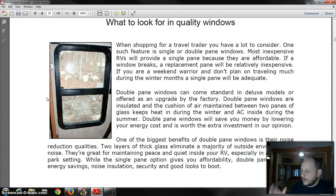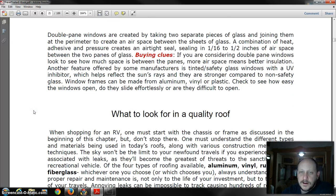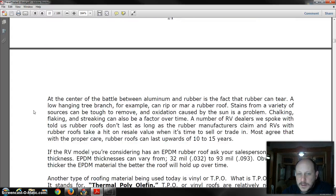If you don't believe me, take a cold glass of iced tea on a hot humid summer day and watch how fast it condenses. That's why if you've got two panes with air in between, that air is a thermal break — it helps not transmit as much heat outside in winter, or let outside heat in during summer. It also helps with noise. Air spaces are beneficial for sound dampening as well.